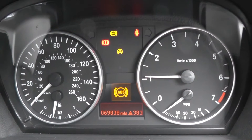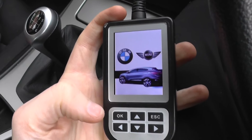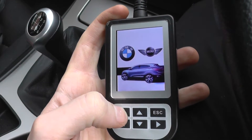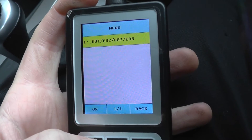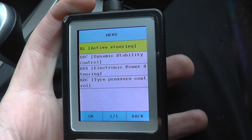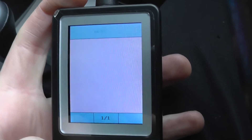Those are characteristics of a failed ABS sensor generally. So what we're going to do is use this BMW and Mini scan tool — it's a C110 scan tool — just to see if we can diagnose the fault. We're in a BMW 1 Series trying to diagnose the ABS system, which in this case is the Dynamic Stability Control, DSC.